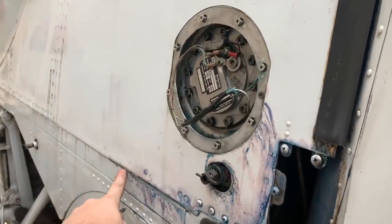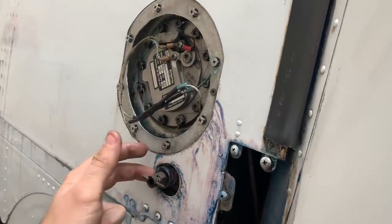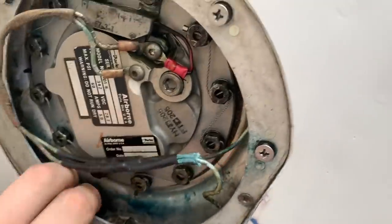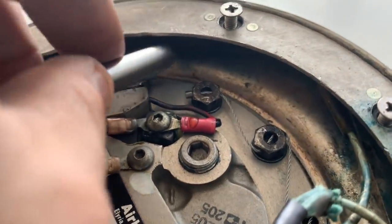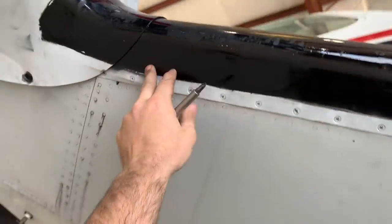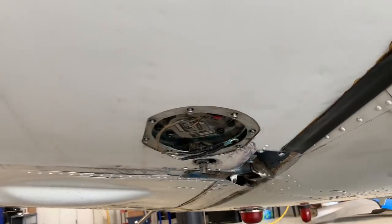It looks like it's got a leak that originates here and comes down. One would originally think we've got a leaking fuel drain, but where it's coming out doesn't coincide with that. If I zoom in here, all that's blue — it's blue towards the leading edge of the wing, and when I go towards the leading edge I also see blue leaking from there as well. We'll probably wind up pulling the leading edge of the wing to determine what's going on, but my guess is that the bladder is leaking, and that's causing all the fuel drainage issues.